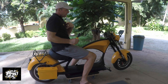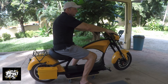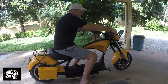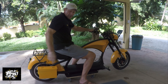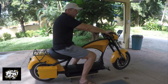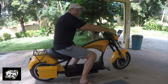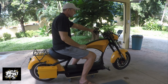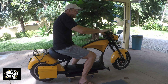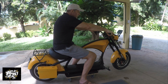Some people told me their acceleration doesn't work. The problem is the two buttons here — the buttons to illuminate the rear brake and activate the recuperation. I had one problem where the piston didn't push the lever far enough back to actually engage at the bottom. It's highly unlikely you're going to have a problem with the acceleration itself — it's never going to be a problem.